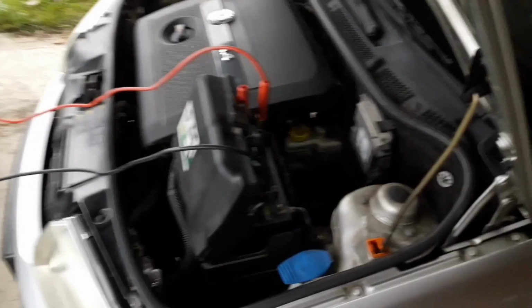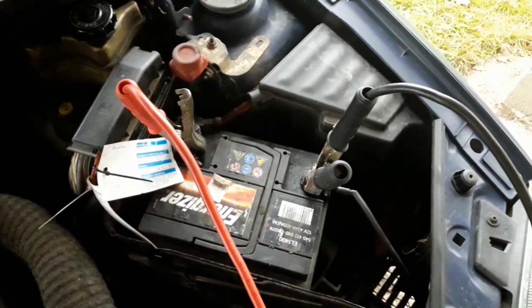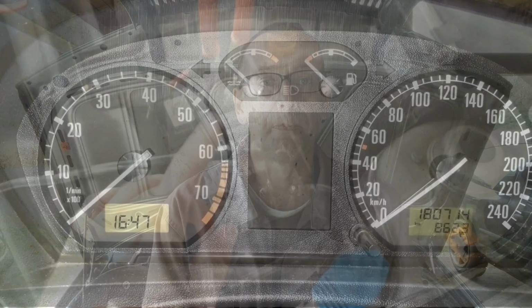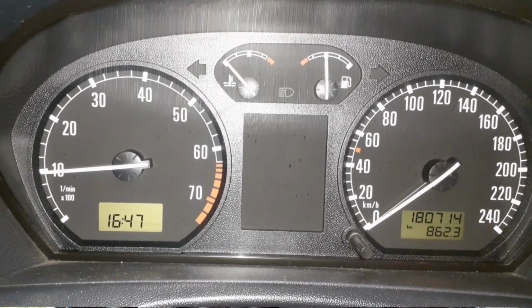Now, when this happens, the first thing you should do is to try and jump start the car. We made a specific video on this topic, how to properly jump start a car. We always recommend that you have a pair of jumper cables in the trunk, and in this case, you should try to find a donor car if you're somewhere on a parking lot. If you have another one of your own cars, you can use that car. If you, which is rare, have a spare battery in the garage, you can try connecting that battery with jump start cables and try to start the car. If after connecting this battery the dashboard lights come to life, there is strong normal cranking, then probably the battery is the problem. But even in this phase, you shouldn't jump to conclusions, but do the next thing.